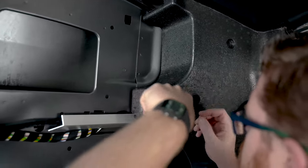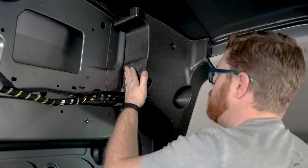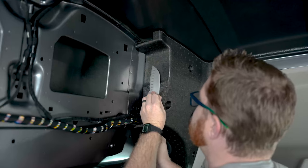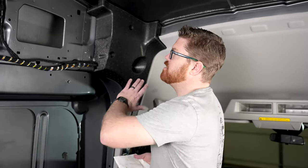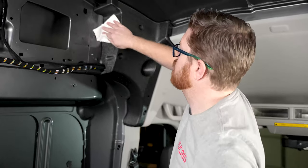You can always pop this pin out. That looks pretty good — we can give it a trim. Now with our blob cut down, we're gonna prep our surfaces. Make sure we degrease this area so we get good adhesion with our glue. We've got isopropyl on a rag and we're just gonna wipe this down.